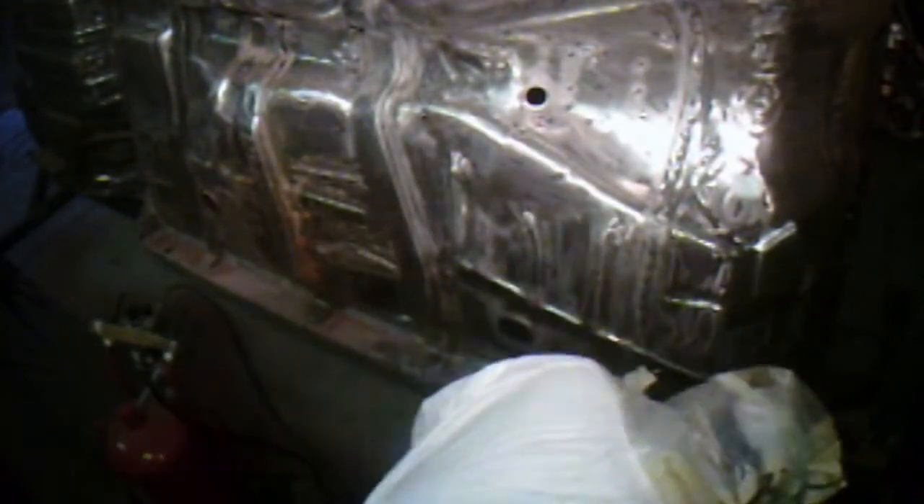I kept going blind when I was sandblasting. When recycling the media too many times it got really dusty — you can't see anything. You need a really strong hard light right on where you're working. I had a tungsten work light on a stand, it was very good, but inside the cabin I had a lot of problems aiming it and kept tripping over the stand and cables. So I got rid of the stand and just clamped the work light directly onto the car — if you could aim it, it was a lot better.